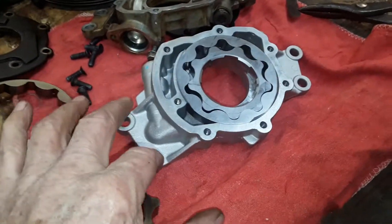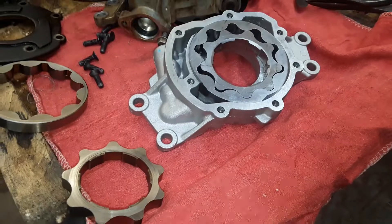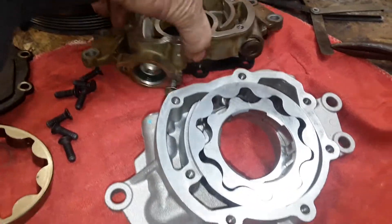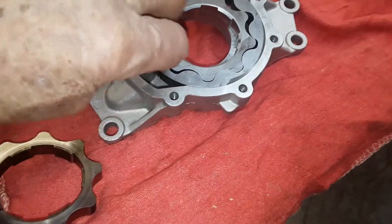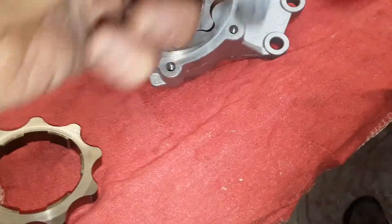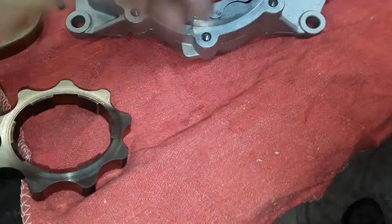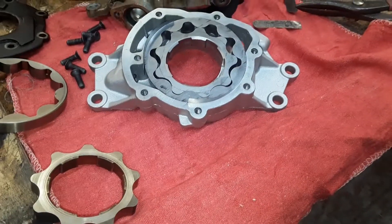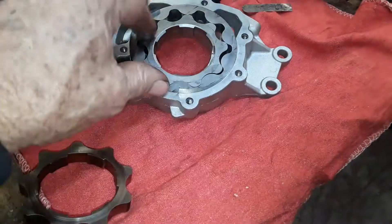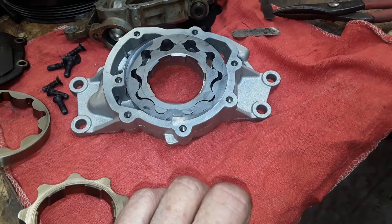This is not adjustable — there's a little float but not much. If this pump is positioned slightly one way or another, because the bolt holes are somewhat larger than the bolts that hold the pump in place, you're going to be fighting with installing the pickup tube. So you put one-and-a-half-thousandth feeler gauges — you can see them in there, there's another one over here. I just cut some off from old feeler gauge sets.